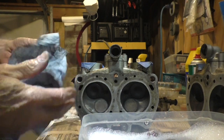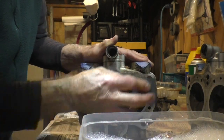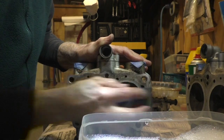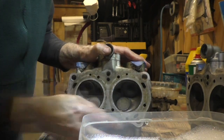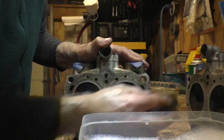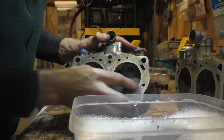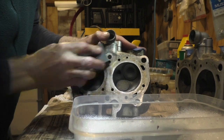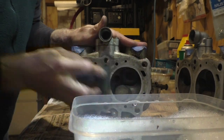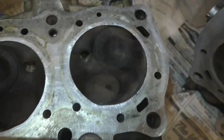That's all that I'm getting is some staining. Modest. I am not pushing hard. I am pushing, but I am not pressing hard. And it's going very quickly. I did not put more than 15 minutes of grinding into that last head. A couple of drops of Dawn dishwashing detergent in my tub of warm water. Even though I am moving this head as I am doing this, I feel like it's very easy to keep the stone flat against the surface. And now I'm calling that done.